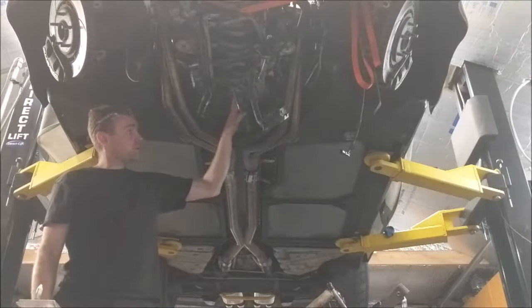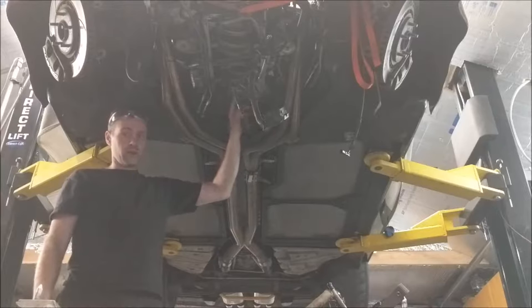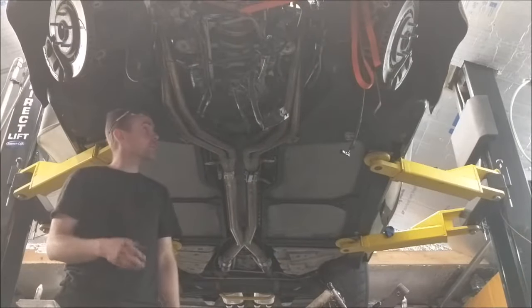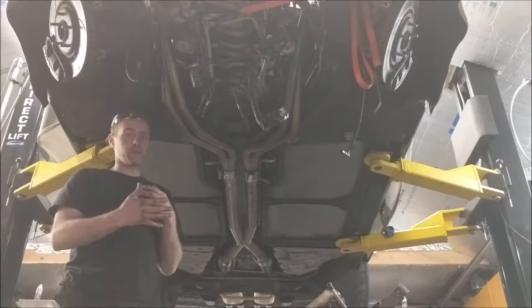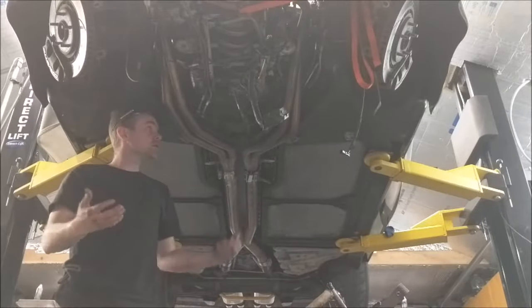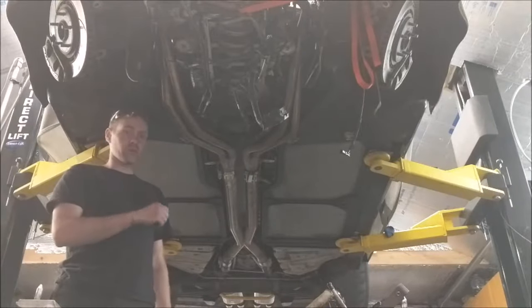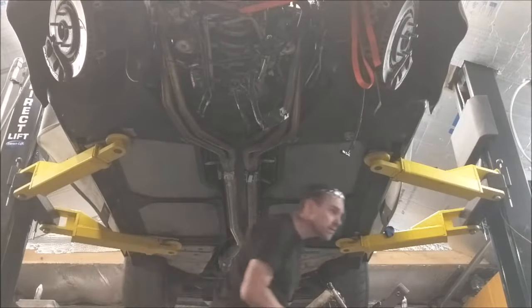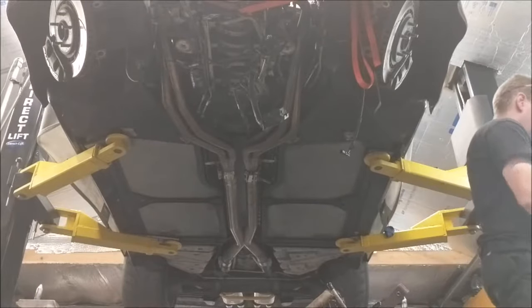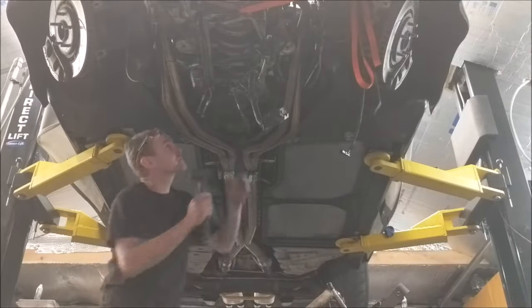I'm leaving the bolts threaded in a little bit. Reason being is you have dowels that are almost like a press fit that hold the connecting rod cap to the connecting rod, aside from the bolts themselves. The bolts are the main structure. So I'm going to use the actual bolts themselves to just give them a little love tap with a rubber hammer. And that'll knock those dowels out of their position or allow it to separate.